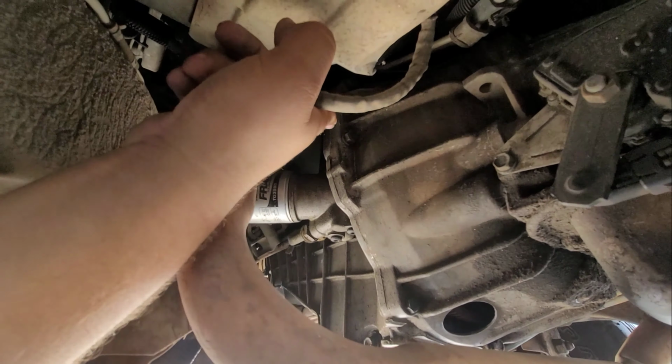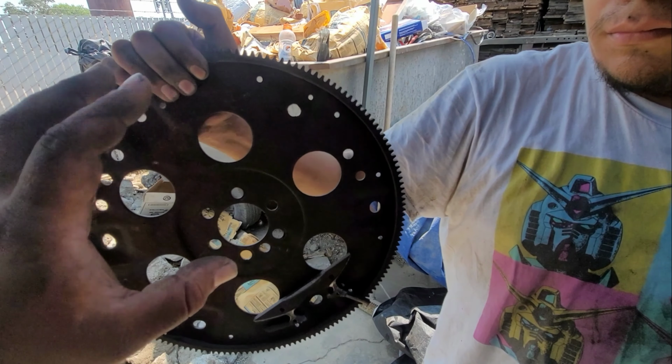This thing, that's why it has like a little weight or a little spacer. It's supposed to be flipped around, and then this is popping up a little bit right here. So it gives you that little space for the torque converter not to sit flush. So what basically he did, he put it on wrong, and maybe that's why it had a lot of play. And where they were driving in reverse, drive, reverse, drive, it started cutting into the bolt until it snapped it off.